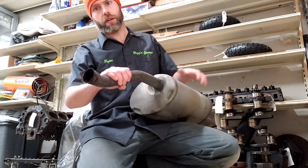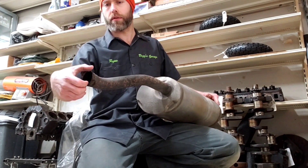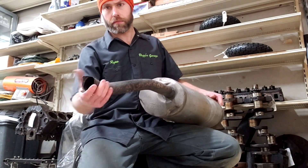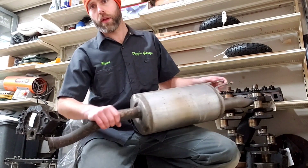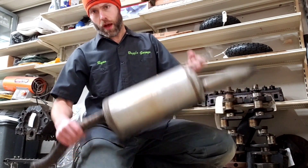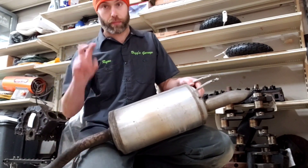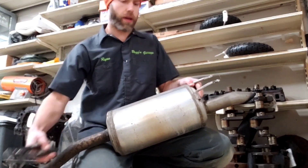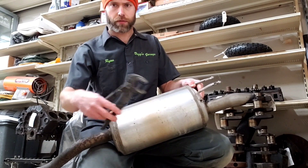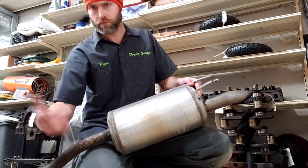They have a spherical flange that bolts to the rest of the piping. Usually it gets brittle, starts to crack, then the muffler falls off. The only thing holding it up will be the exhaust hangers. I went ahead and took mine off — you can just use some channel locks and pry it off the hanger. Easy.